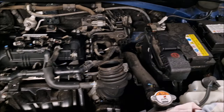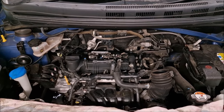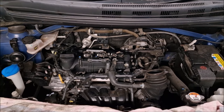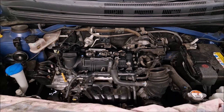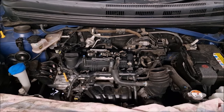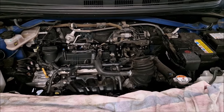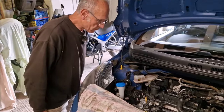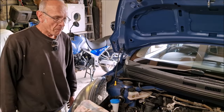I've hung the battery lead on, taken that glove off there so we can get some compression. Go on then. Well, I was expecting that rattle. What was the rattle? Timing chain tension filling up with oil. Just filling itself up. I hate to say it, but I can't hear the shushing. It's gone. I can hear that whine now.